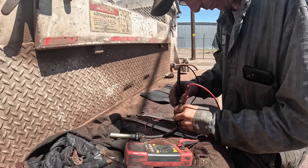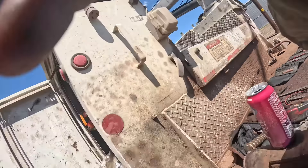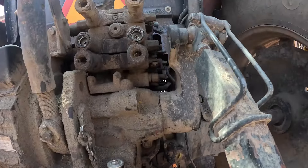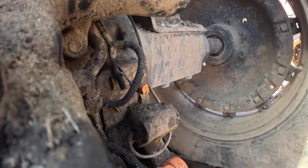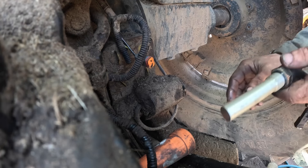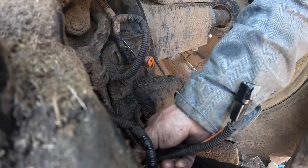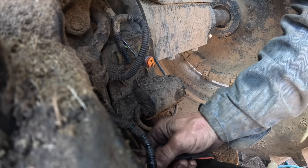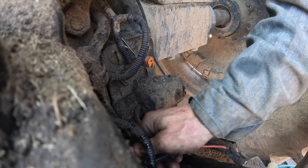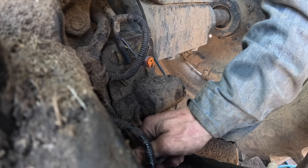3.14 ohms. I wonder if it changes when we put it back in the tractor. I checked it the other day and it was in spec — it's out of spec now. After this whole thing with the coil the other day on this park-lock solenoid, if it ain't dead on then I probably should replace it. According to that, it's out of spec.